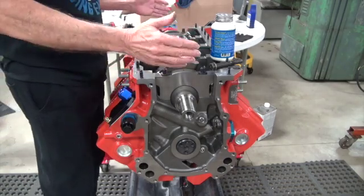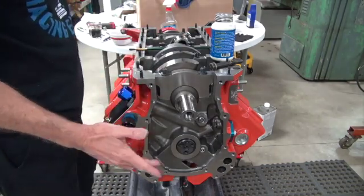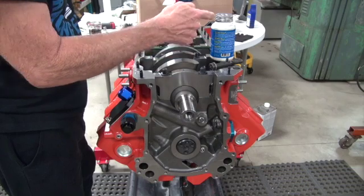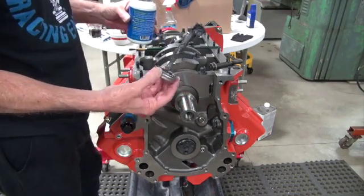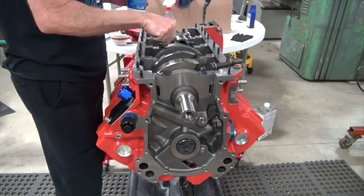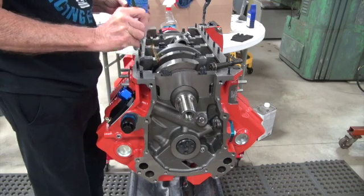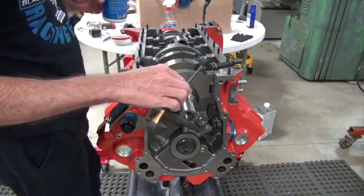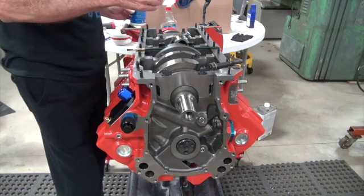I don't know of a Mopar published sequence of how to torque that, so you can do whatever you want. I just start in the middle and work your way out. It doesn't matter, I don't think. The main thing is, you want your fasteners clean, and then you put some ARP lube on here. I know ARP thinks that's a great brush, but in reality, they obviously have never put together an engine if they had to try to use that thing. You can go to Walmart and for a couple bucks they'll sell you these little artist brushes, and you can brush this stuff on your studs and on the top of the washer. They want the bottom clean, I think, so it doesn't try to spin there on the washer instead of down there. But that's about all that is.